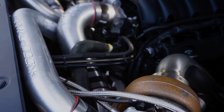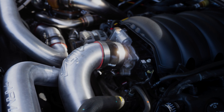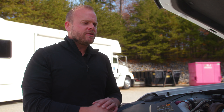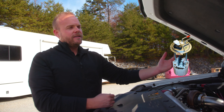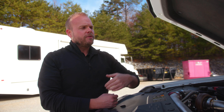With this truck, now that we've done the install of the turbo system, we needed to add a bit of fueling upgrades as well. So we use the Armageddon LT4 high side fuel system, which comes with a set of eight high pressure injectors and a high pressure direct injection pump. Feeding that is the Armageddon 465 liter per hour lift pump, which provides the gasoline from the tank all the way to the high pressure pump located on the engine on these direct injected vehicles.